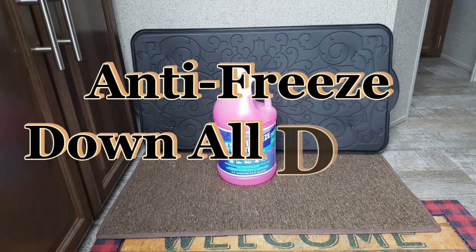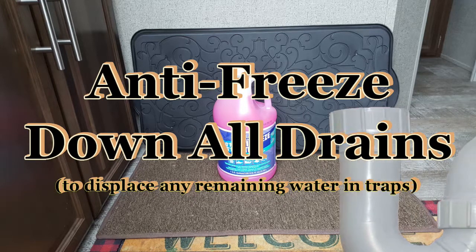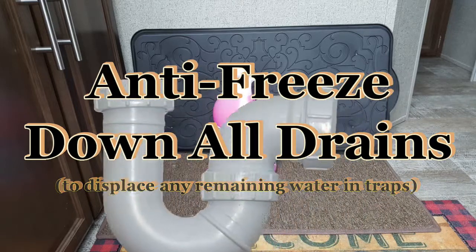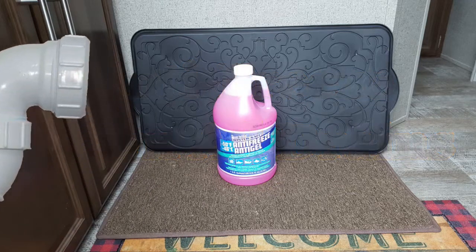Even if you don't pump antifreeze into your lines, you should still pour a little down each drain to displace any remaining water that's left in the traps. Some additional antifreeze will spill into the gray tank at this point, and it'll help protect it as well.